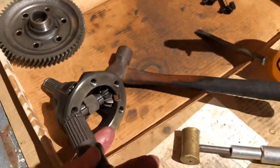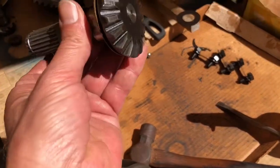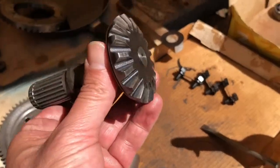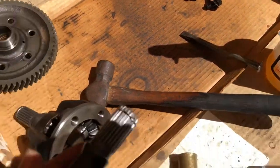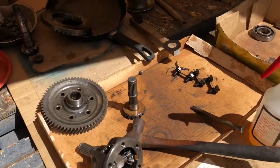A-plus stuff. I'm in favor of reversing the load direction when possible. This was in a 998 late A-plus box. You can barely tell which side was the direction of wear, but I'm taking it end for end, so that all the ones that were coasting are now going to be taking the load — using brand new surfaces.